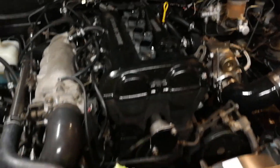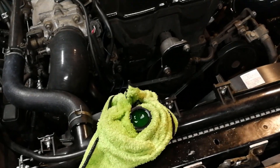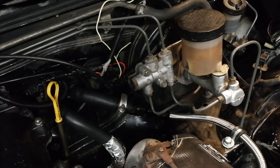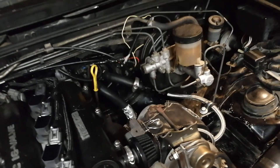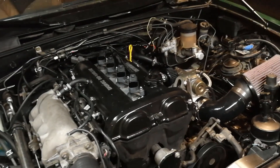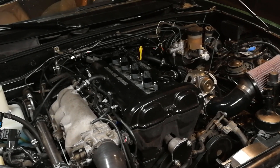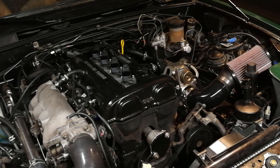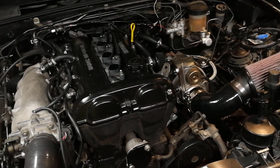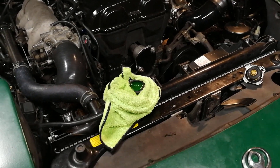Spark plugs are in, sound good. I'm going ahead and bleeding a little bit — I replaced a line in the back that got cut somehow, which is what made it leak. It seemed otherwise in good condition but had a little cut in the top of it, maybe from a screwdriver. I cut a new piece and put it back on. Since it's so high in the system, I just did it in place and introduced a small air bubble, so I'm letting that bleed out.